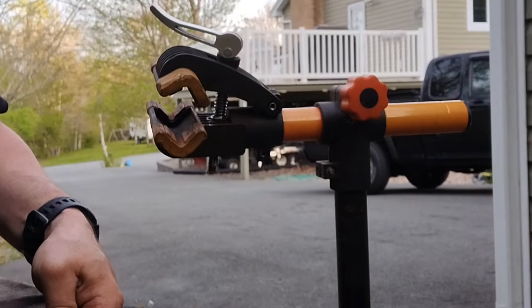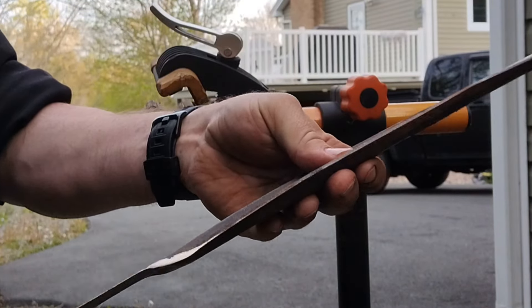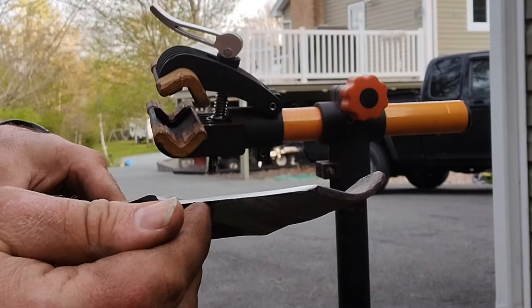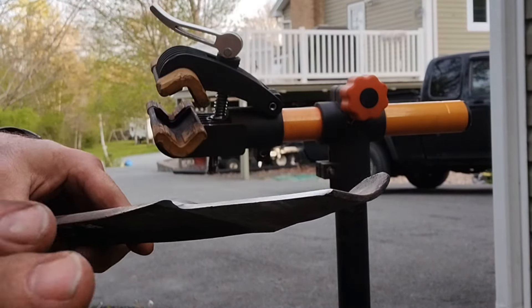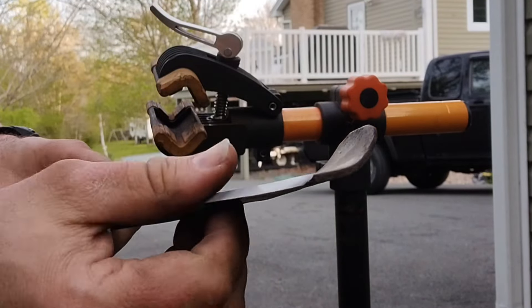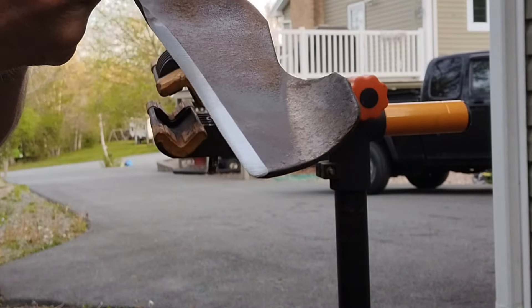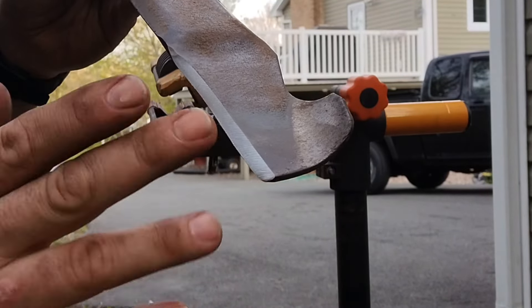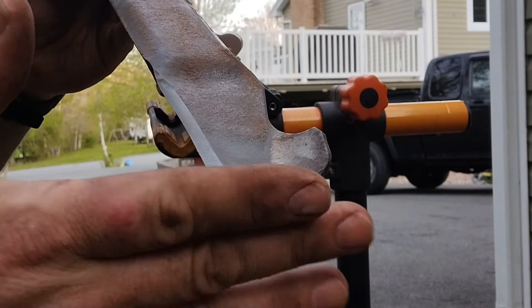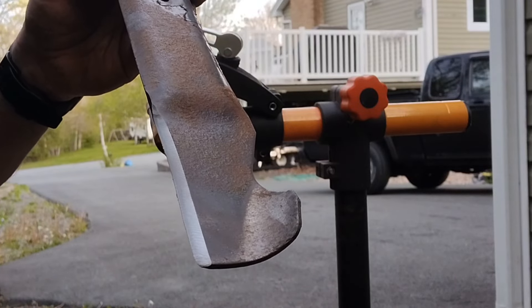You just do a quick little drag across the bottom of the blade on each side. There's a little burr left over when you're sharpening and that takes the burr off. You can dress this with a file real fast — I sometimes do that with a diamond file. Sometimes if it's a small burr I just rub it off. It looks like a brand new blade now. I could have taken this back a little further because I really want a 90-degree edge here, but as they say, it's not a space shuttle — it's a lawnmower.